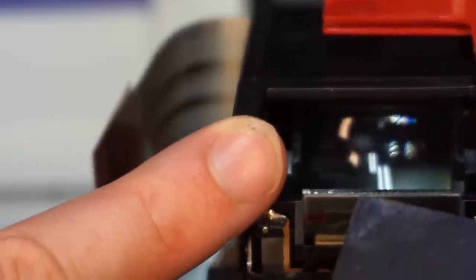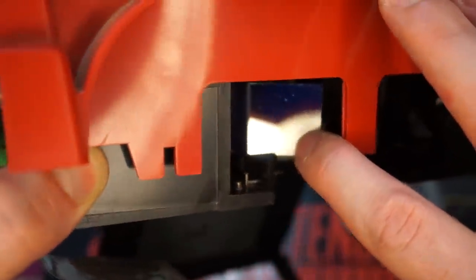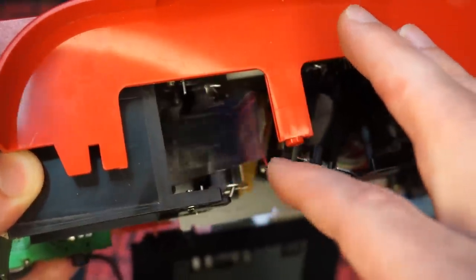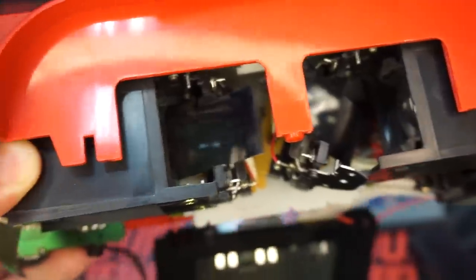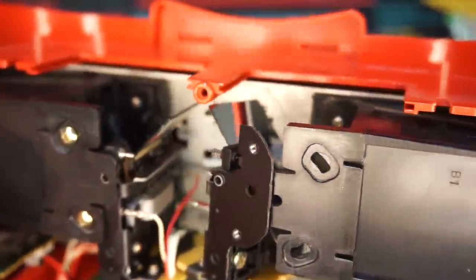So just like I said 2 seconds ago, there are two screens, one on each side, to create two images, just like it does for the 3DS. Now, these individual screens, however, do not face your eyes directly like you would imagine. Instead, the images are reflected off of these mirrors, and these mirrors are what your eyes will see for the majority of the time.